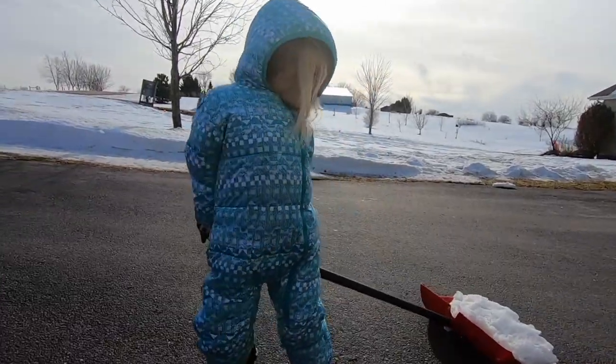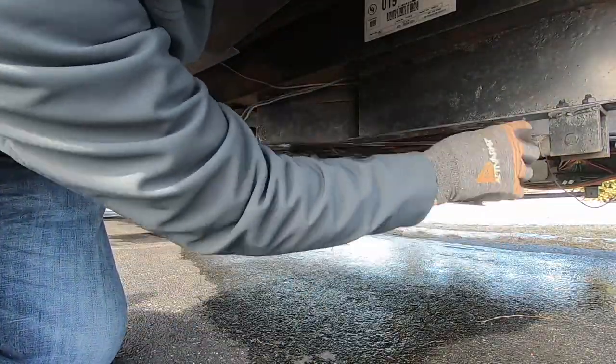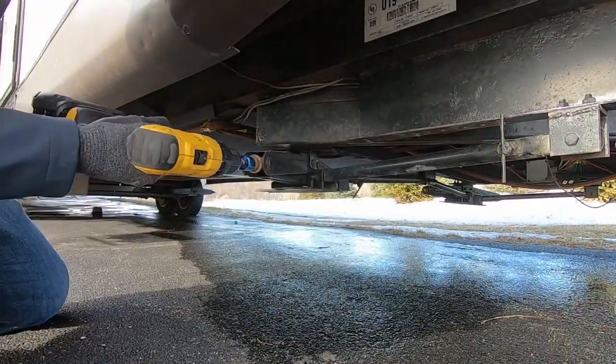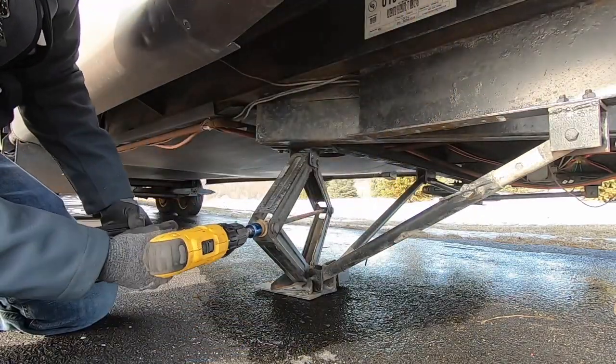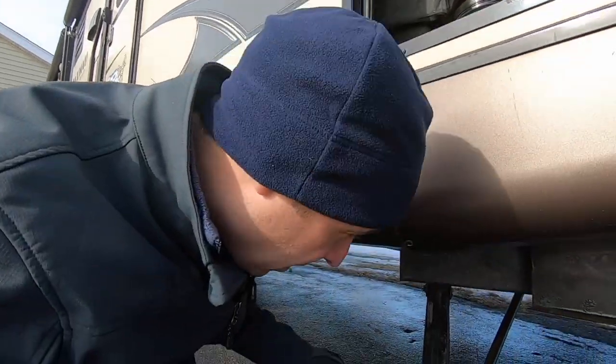When we get somewhere, I come down under here, unscrew these a little bit, reach under and unscrew that one as well, then take my DeWalt drill to tighten these up and give it one more turn to make sure it's in there. Those stabilization bars essentially lock this jack in place.